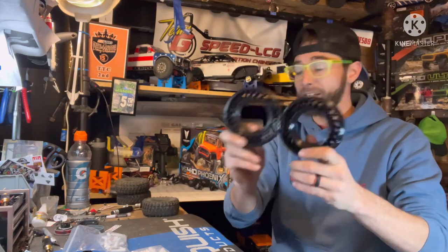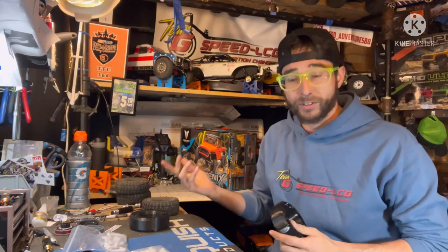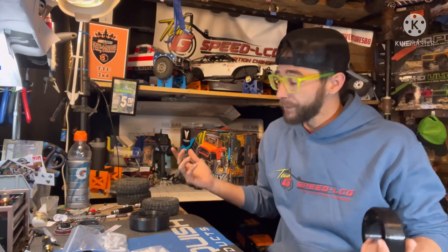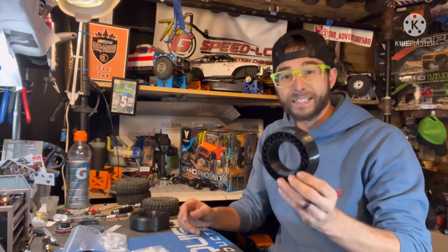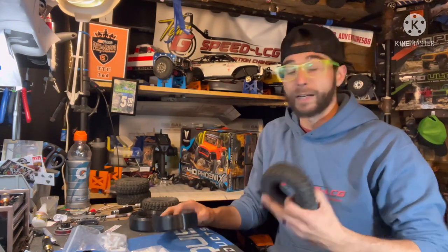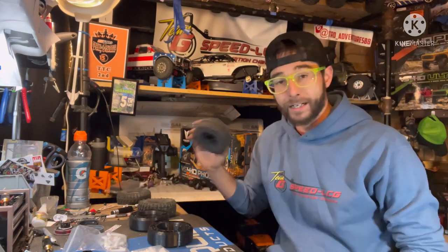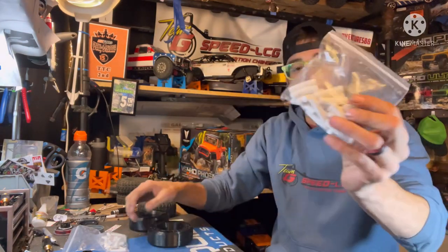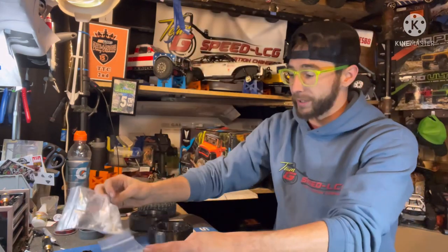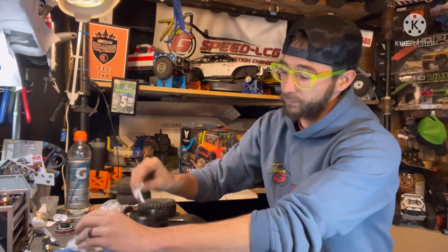So where are we at? We're going to mess with some more of the anti-foams from Three Brothers RC. In the last video I went through, got them all installed, went out, took them on a test run and was very impressed. What I'm working with here anti-foam wise is the 4.75 single stage soft — that's how I ran them the first time. I didn't even have my tires vented and was still super impressed. I have now vented the tires. We also finally got in some of the tuning rods — the larger diameter and the smaller diameter tuning rods.